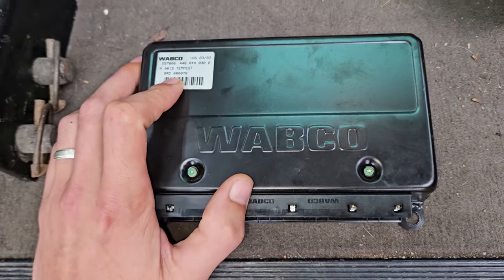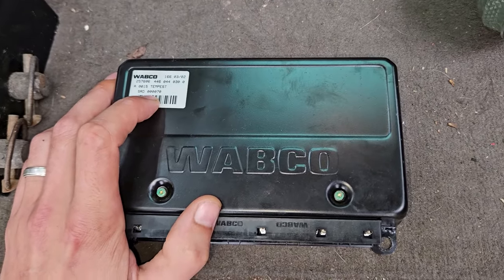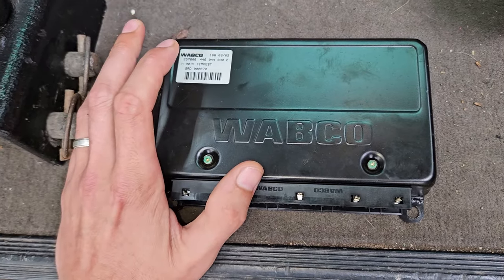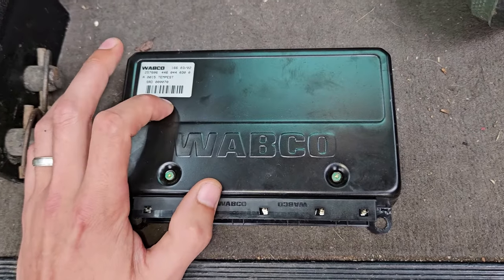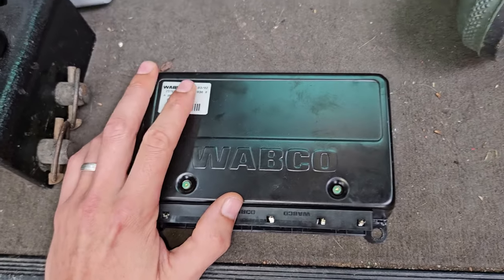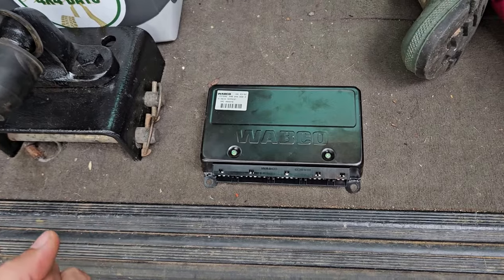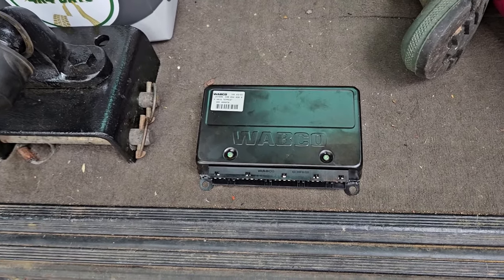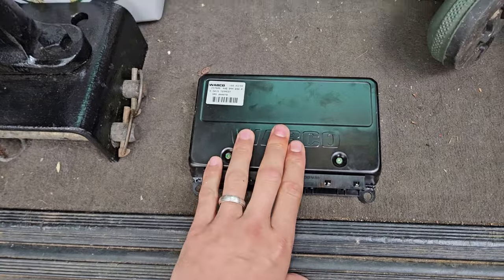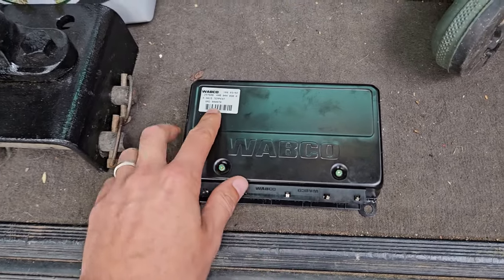Now I think when you engage the centre diff lock on the 2004 version, you could do it with the engine on or off, and it would recognise what's going on and make the ABS and traction control system less aggressive, so it wouldn't break parts, because it's aware that it is engaged and needs to work with the centre diff lock. Whereas from the research I've done, if I engage my centre diff lock with the engine off, then start the vehicle, the ABS traction control system would be completely switched off and it would be all centre diff lock. But apparently the best thing, to make it as capable as possible, was having the centre diff lock working with the ABS traction control system.